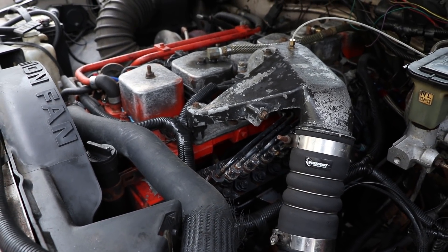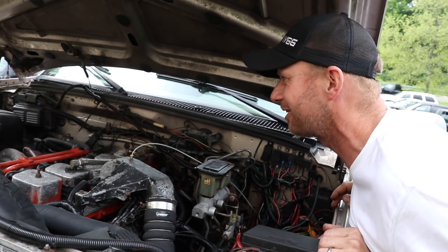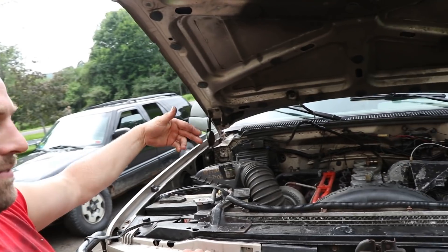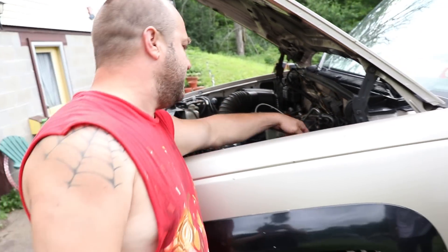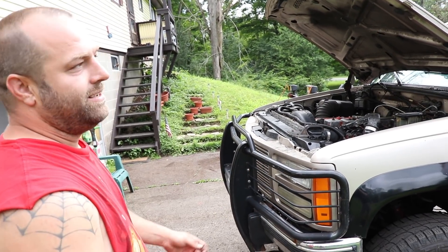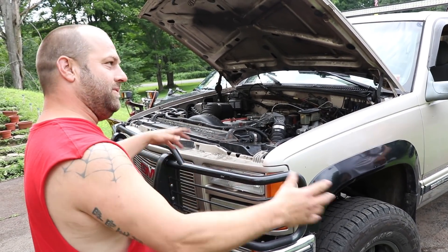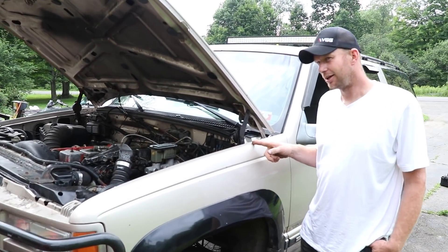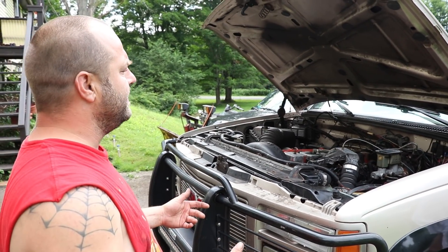This is almost as much Dodge as it is GM. It's kind of unique because I've never seen it done this way before, but it works great. It's a complete Dodge driveline all the way to the rear end — the rear end is the only thing that's GM. The driveshaft is Dodge, transfer case, transmission. The only wiring harness left that's GM is one that goes to the taillights. I wanted the cruise control, so I got it by doing the whole driveline. I wanted overdrive everything the way it was supposed to be. And that's probably still cheaper than buying the adapter plate and the transmission controller. After selling all the parts from the 6.5s, the truck actually paid me like 600 bucks.